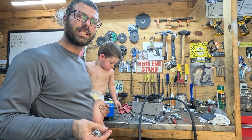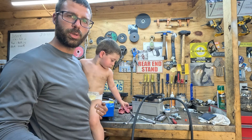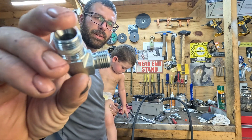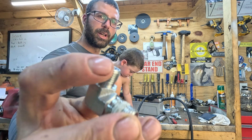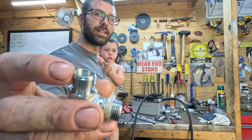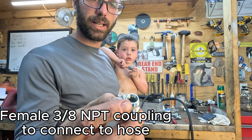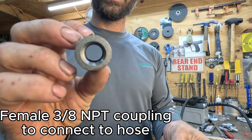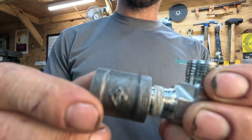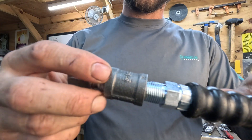We need to be able to adapt our 3/8 MPT hose to an o-ring style 3/8 fitting, which is included if you pull that out of the old hand pump. So we have 3/8 MPT and 3/8 o-ring style. Something you won't have with the pump kit is that female adapter. Here is our 3/8 female coupler, so we'll just be screwing in like this — and in theory, screwing in like this.